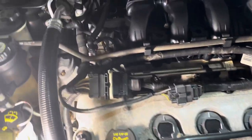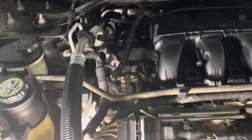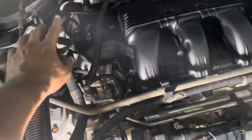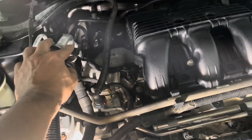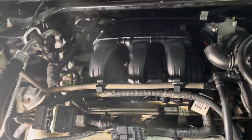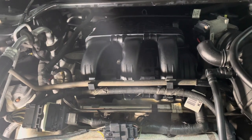We are done here. I do have another issue — I need to add refrigerant. My AC compressor is okay and everything is good, but my vehicle has low refrigerant. We're going to add the freon — there will be another video for that. That port right there is the low pressure port, and this one is for the high pressure. We're going to crank the engine, run the AC, and add the freon from the low pressure port until it's cool and full. Please stay tuned for that video. I hope you liked this video and it helped you learn how to do your engine oil service yourself. Please give us a thumbs up and be part of our community — thank you so much!